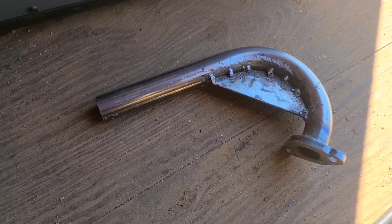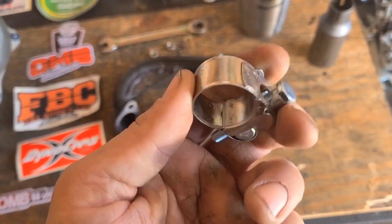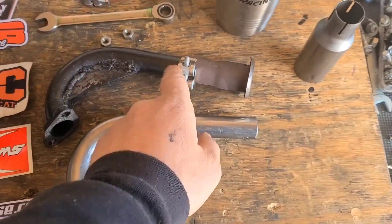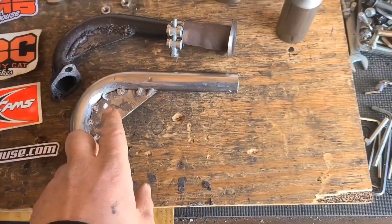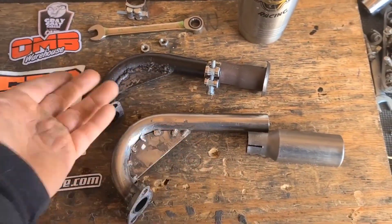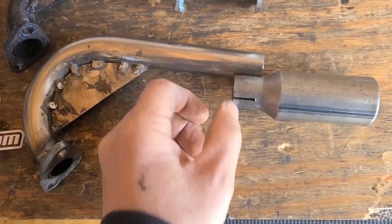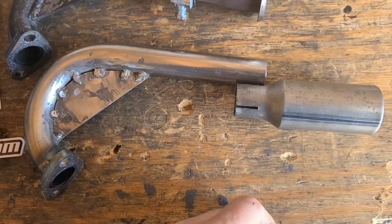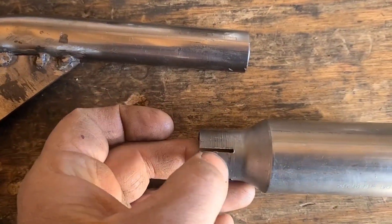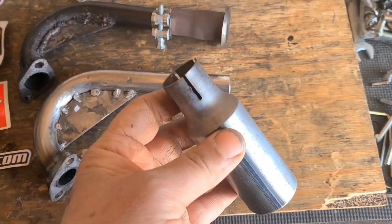Next, we're going to take a look at that Mini-91. This exhaust comes with one of these 1-inch RLV stainless ring jobs — we'll keep that for something else. Since I already have the FBC power horn, it would be nice to just have a pipe that can bolt on, is a little quieter, so I can just switch between the two. I'm going to put it on so that the end of the pipe comes to the bottom of the angled section, and I'll be welding along these split parts here and around the end. I'll spread it out and take my time.